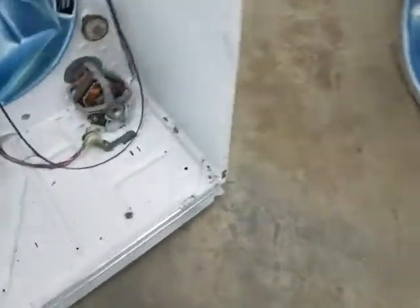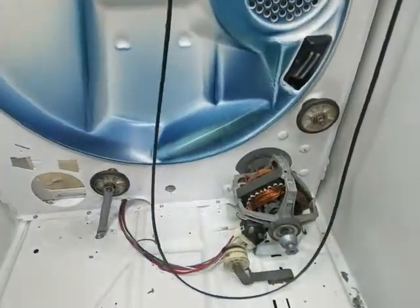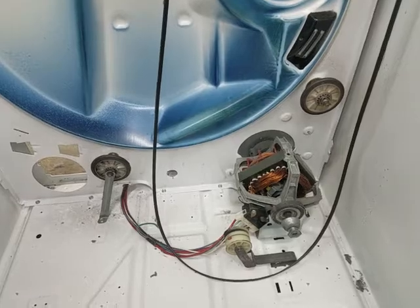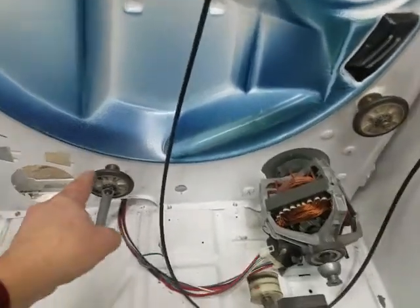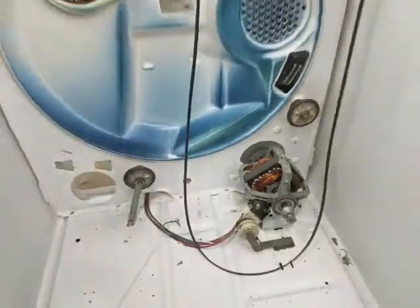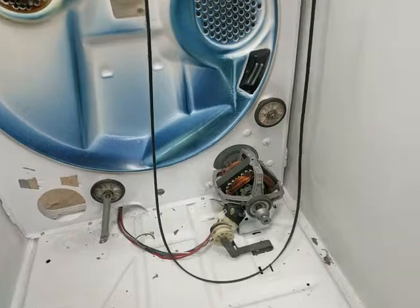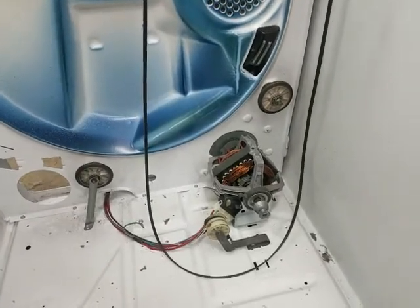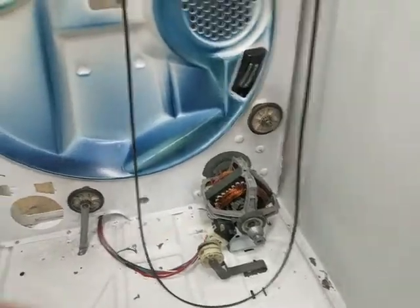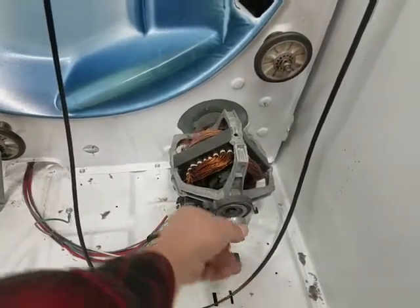And you get to looking in here. I already looked on Amazon, and Amazon sells a fix-it kit for these things for $32. $32 gets you a new roller, a new idler, and a new belt. That's all that goes wrong with these, except for the heating element. The heating element's a little more expensive, but regardless, what goes in these things is not the motor. The motor's always just fine, unless you overheat the hell out of it.